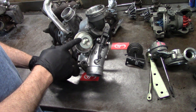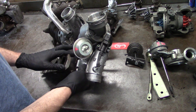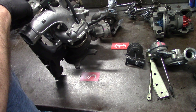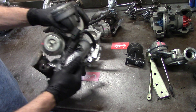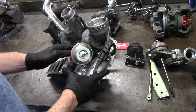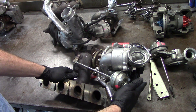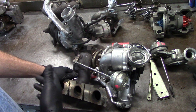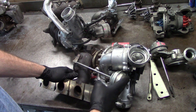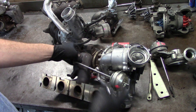Whatever spring pressure that your actuator is set at is going to be the lowest boost pressure this vehicle can do. To make the math simple: if this is a 10-pound spring and your compressor is putting out 10 pounds of boost, it's going to open up that actuator and give it its lowest level of boost possible. The only way it's going to raise the boost pressure by holding the rod in longer is when the computer gives a false signal to the actuator. What that does is it actually bleeds off the extra pressure — so it could have 20 pounds of boost in there, it'll still only show 8, 9, or 10 pounds of boost here.